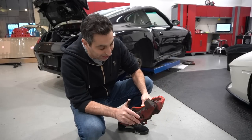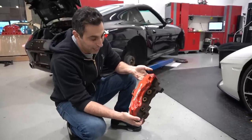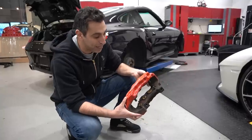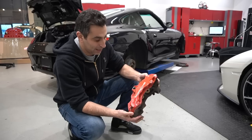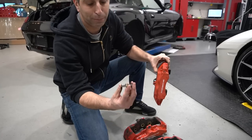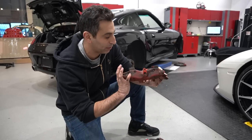These calipers are off a GT2 or a GT3 — they have the big six-piston calipers, you can tell by the giant size. They're a little bit worse for wear. We're going to have these things blasted and recoated. I don't exactly know what color — if you have any ideas, comment below. I was thinking a Grigio Telesto or a grayish color to go with the black. These are the fronts and these are the rears — the regular four pistons. These are going to go to the garbage, we're going to get new ones and new pads. These calipers are going to be refinished — you're going to love the end product.